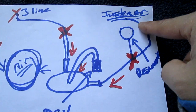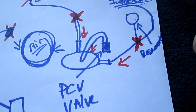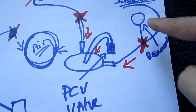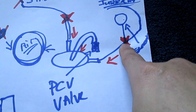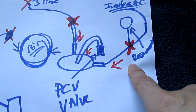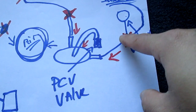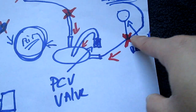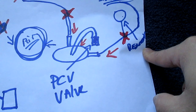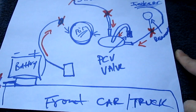Let's say if you put it on below — like where, below the seats and stuff — then one actuator would just suck in and open and out. So that's all there is. That line there goes into, let's say, your heater. This one is just a reservoir. Now, if you see in this video — here, you see the reservoir — it's hanging out. The S10, or the '96 on, the S10 is actually smaller, so they rerouted it on the fender, which I actually mentioned in the video.